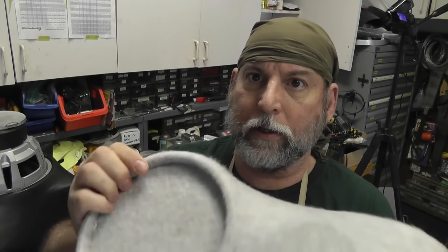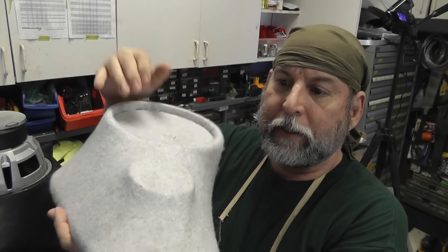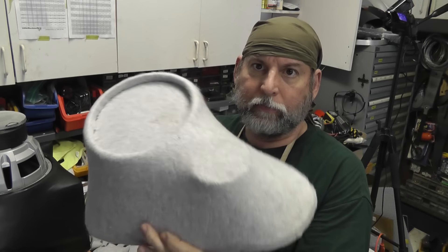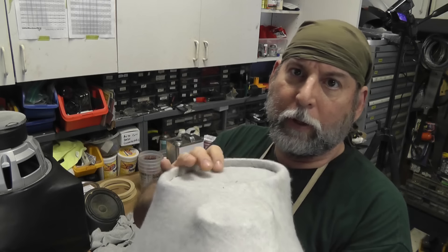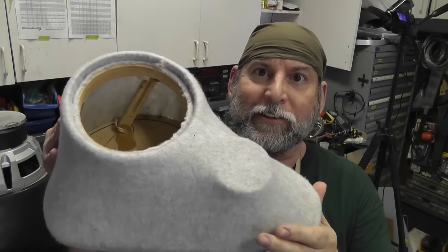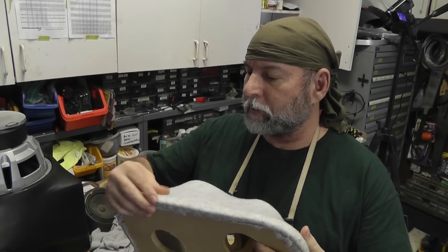You can see what I've done — it's actually tight as a drum here. I'm going to cut this part out with the razor blade. Remember, we can either drill later for a tweeter or do a surface-mount tweeter. The bottom is pretty much clean — we clean this up later — we just want it to lay flat while we're working on it. And there we are, ready for fiberglassing finally.